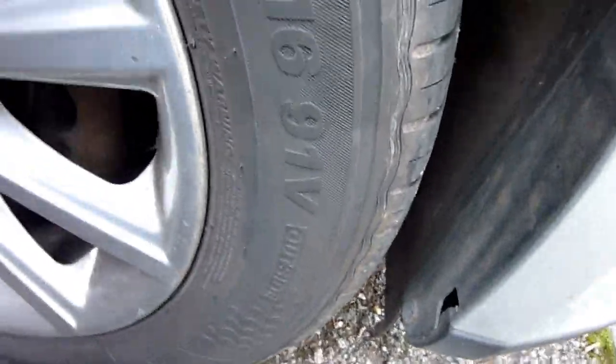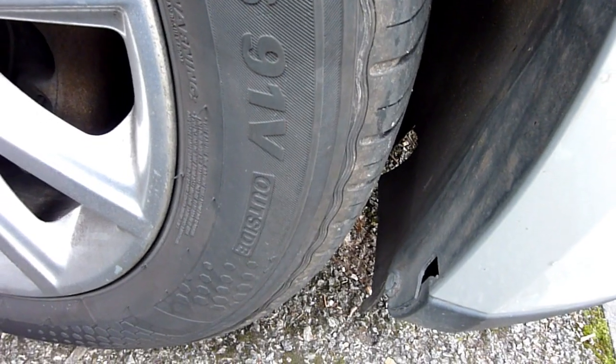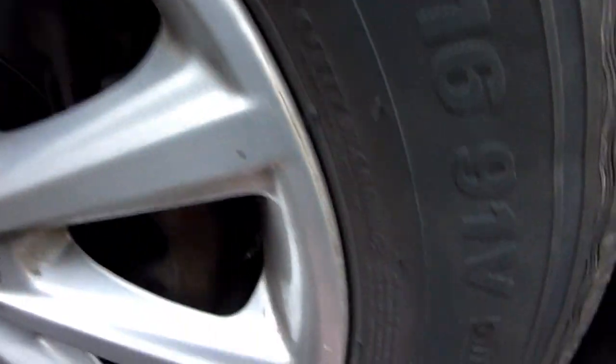Do the same to the other side. The most common failure is really the steering. Check the state of the tires and check the tire pressure on all four tires — I keep my front ones at about 33 to 34 PSI and rear ones at about 32 to 33. Check there are no bumps once you've jacked the car up. Also check the inside of the tire, not just the outside. Check there are no bulges and that it's wearing evenly.